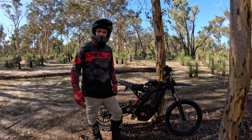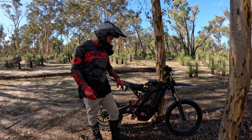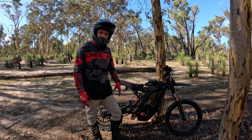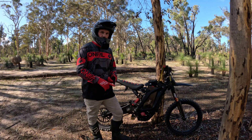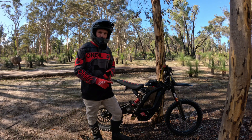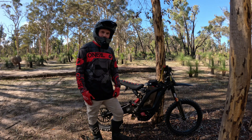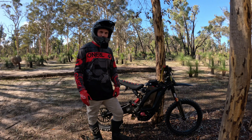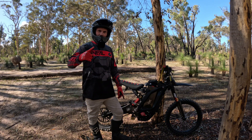As you've seen with that screen recording, the max kilowatt I was able to pull from the bike was 22 kilowatts on this current setup with this gearing. The bike was set at the 30 kilowatt setting in the EVMX map, 400 battery amps and 900 phase amps. Even at 22 kilowatts, that's still a lot of power — I still struggled to keep the front down and had to sit right on the front of the bike. Thanks for watching, I'll see you in the next one.